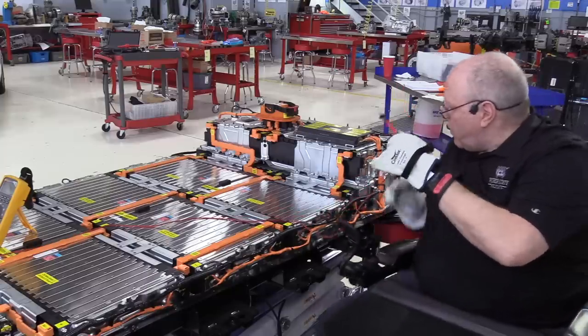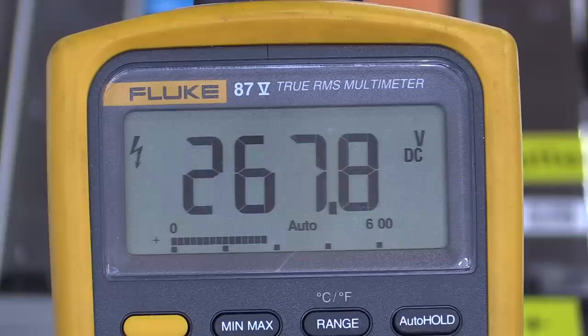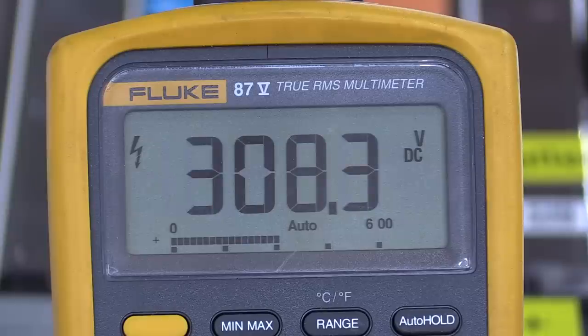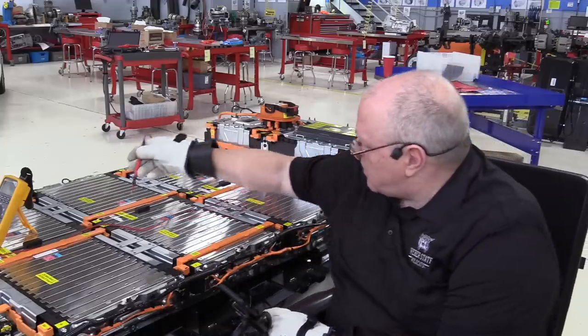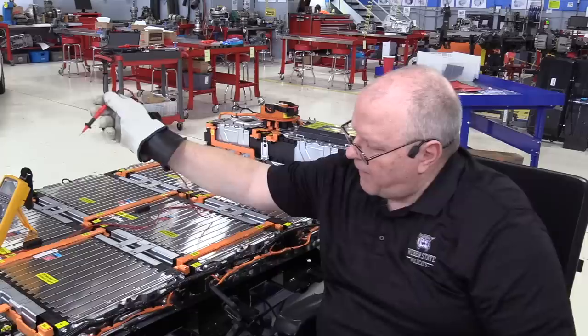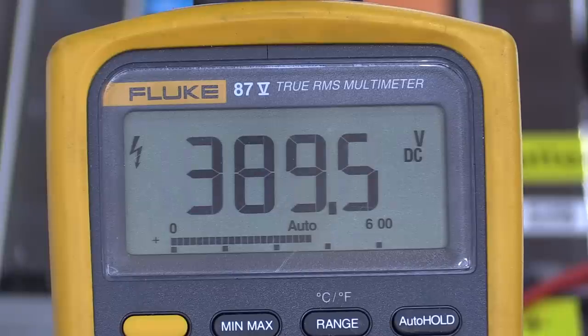Okay, and then if we go down to battery module 7's positive terminal, we're going to add another 32 volts, and now we're at 267 volts. And then we go to battery module 8, add another 40 volts, now we're at 308 volts. Then battery module 9's positive terminal, add another 40 volts, now we're at 348.9 volts. And then finally, battery module 10, add another 40 volts, and our overall system voltage, fully charged, is 389.5